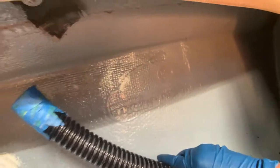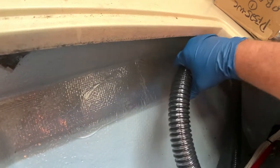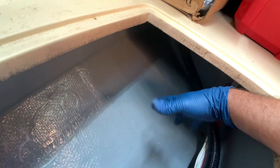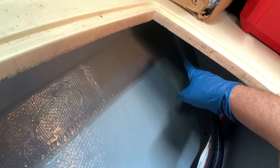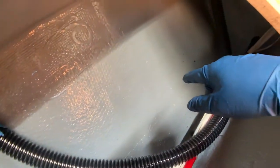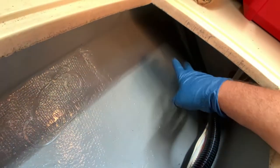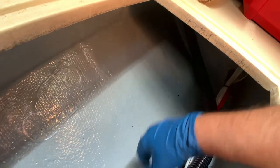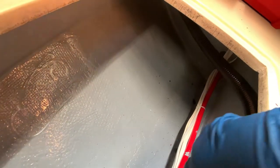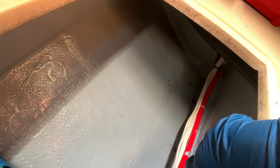Everything is nice and out of the way. I installed our new water intake hose and made it extra long so it can have a curve and sit on top of the tank. As the tank moves up and down from being full or empty, there won't be any kink. Originally it was tight all the way to the end, so there was really no way for the hose to move. My guess is they never got full capacity on the bladder because it was pinned in a corner. With the big loop, when it goes up it comes out of the way, and when it goes down it goes down with the tank, always allowing the tank to fill to capacity.